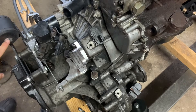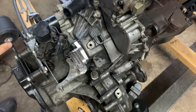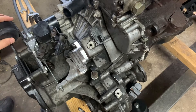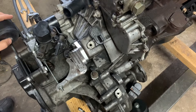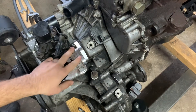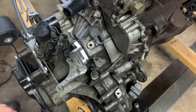This is the trans mount. On Eurowise's website they make a note: if you want your engine to hang lower or higher, you either rotate this to the bottom or to the top. I have it set up for higher because I want a lot of clearance — my car is super low, and it's easier to take the hood off than be stranded on the side of the road without oil on the first test drive. I also had to go ahead and cut new threads into the bell housing itself, which kind of sucked, but I got it to work.